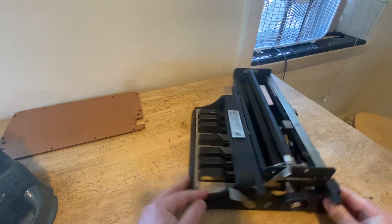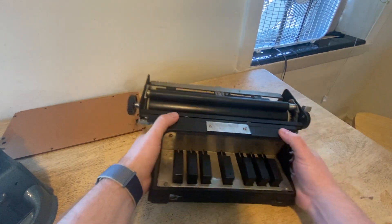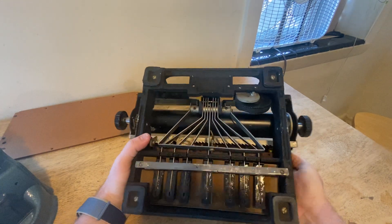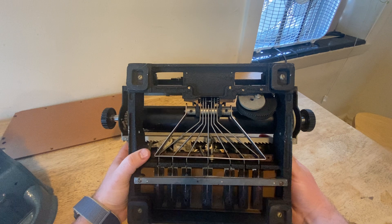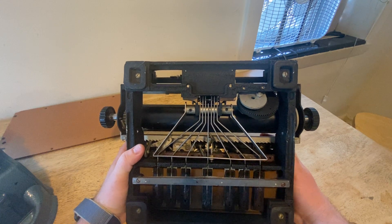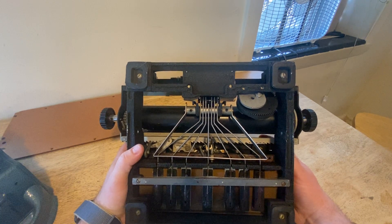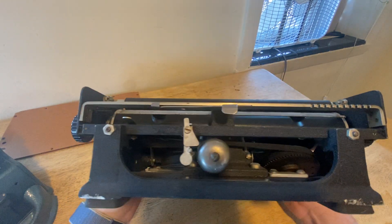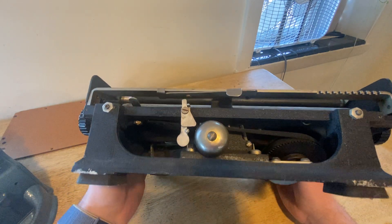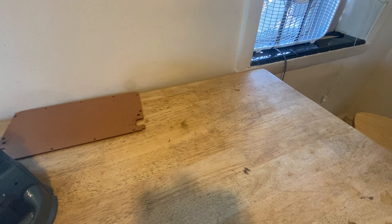The Perkins Brailler is different. Two more things about the Newhall Braille writer: if I flip it over you can see that the levers from the keys radiate inward to where they are underneath the embossing head. It's pretty straightforward — you push down on the keys and it pushes up on the piston that makes the dot. And then the back view shows the mechanism that pushes up, and you can really just see the bell, which is the other typewriter-like feature.